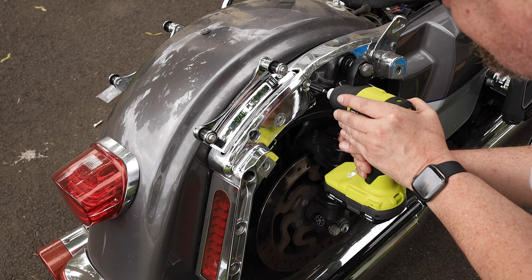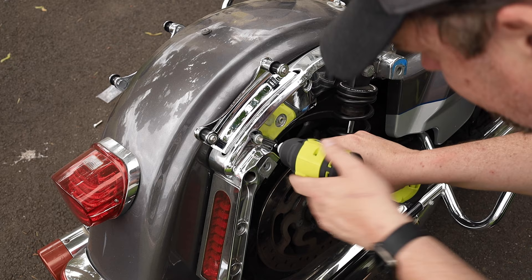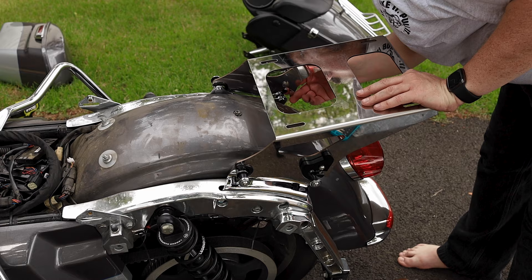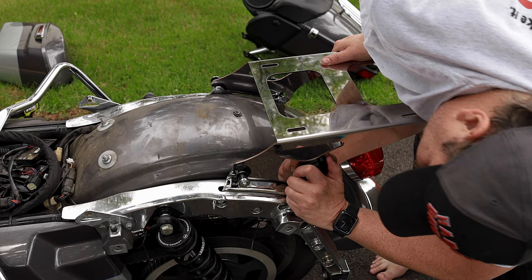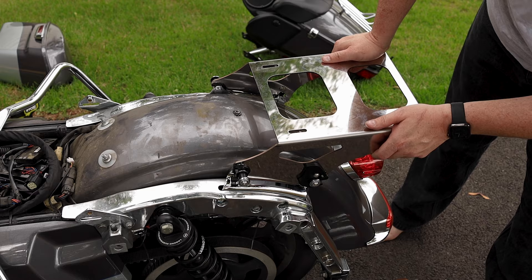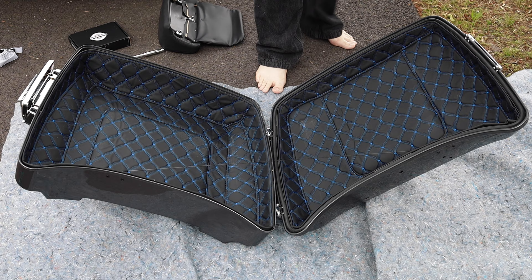I would say this install took about three to four hours, and I'll get into why I did take my time with it. I don't have the license plate relocator kit installed here — I did install that later after I finished the video. Now we're just going to put the bracket on. One thing the guys from Northcote Bagger recommended — I'll put a link in the description — is to put this on and let it sit for a few hours so it can sort of adjust and stretch out a little bit. Because it's so new it's going to be really tight. It took me a few attempts to get it installed, so I left it for a few hours to stretch out, which made the install a lot easier.